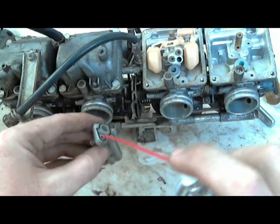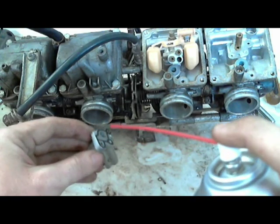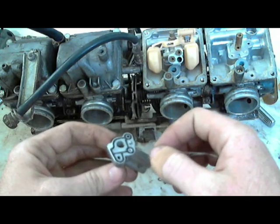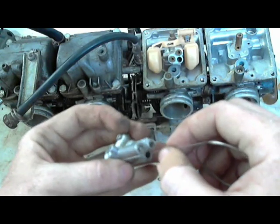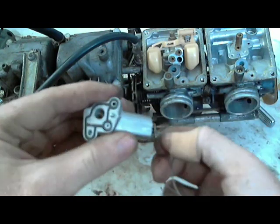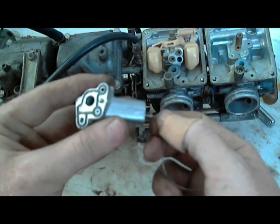then spray through. And you'll see a little stream come out. I don't know if you can see that on the video, if the camera picked it up, but this carburetor cleaner sprays out the bottom whenever I spray through it like that, which is what you want. You want to make sure it's getting clean. And just a little bit of carburetor cleaner on this seal isn't going to hurt it. I believe the long-term exposure of the part to the carburetor cleaner will expand the rubber. It actually smells a lot like brake clean, and I've always thought that they were about the same thing, but I am not going to try to use one in place of the other, even though they smell the same. It can be made with different mixtures of stuff.